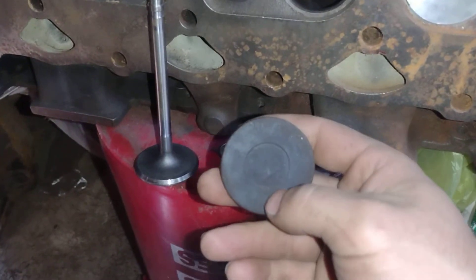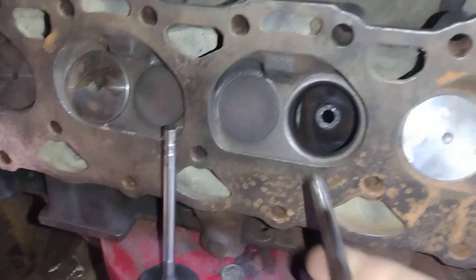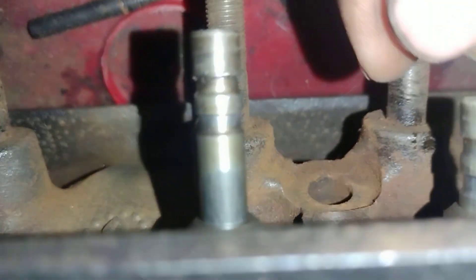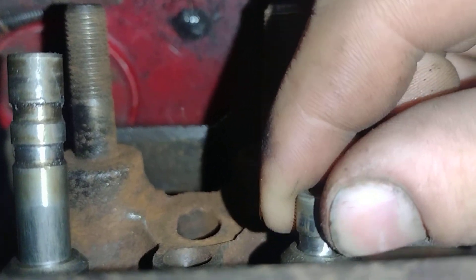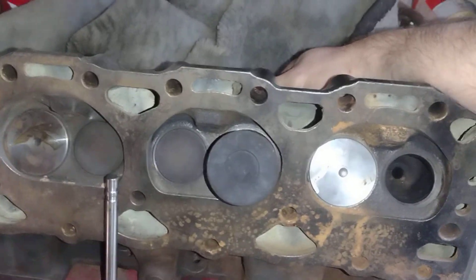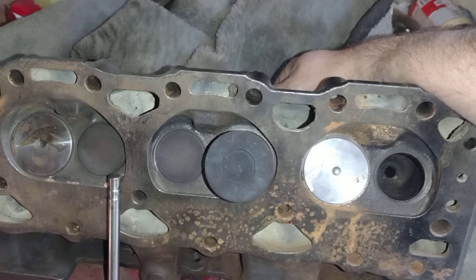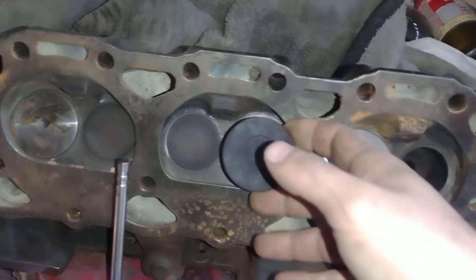What I was trying to do — I'm not really doing it for compression — I actually wanted to replace these intake valves originally because I took a file, and sometimes when you're disassembling heads and you take these valves out you'll get a little burr. It'll catch on the guide when you're taking them out, and you have to end up taking a file and filing it to get them out. That's what I did to a lot of the valves, and that's why I'm replacing them — I don't want to put keepers on and risk dropping a valve.